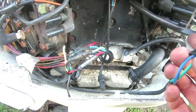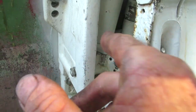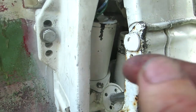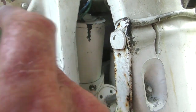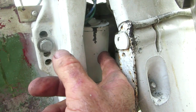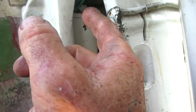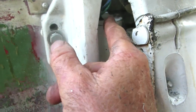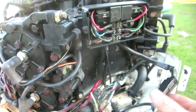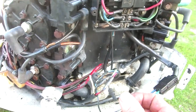The green and blue wires run straight down into here, come out the front, and go to your motor. In my case, just to eliminate all problems, I took the cover off the motor. Even though I think this is a new motor, I popped that off — fluid spews out when you do that. I verified I had continuity between the two contacts where the brushes are and these two wires up here.